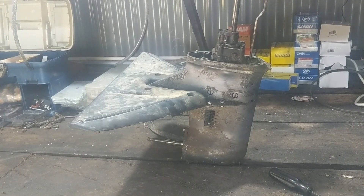Good morning YouTube. This video is going to be how to pressure test an outboard motor lower unit. This is a lower unit from a Yamaha 9.9. I found water in the oil, so we're going to be identifying which seal is bad so that we can repair it.